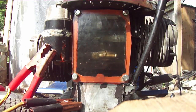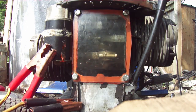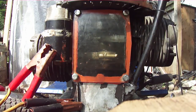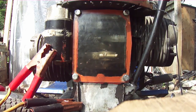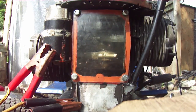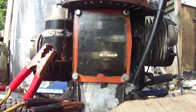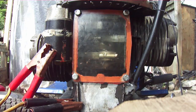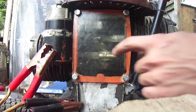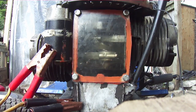The battery - well, the one tractor battery's dying. But looks like about half-inch overfilled is the best way to go with these - it seemed to even exceed the severely overfilled test. Figured I'd try all case scenarios and yeah, looks like half-inch overfill is the best way to go. The next thing to test would be to start the engine and then see how low it can idle before you lose lubrication to the top end - so that'll be the next test.